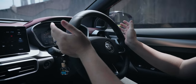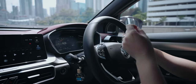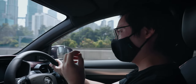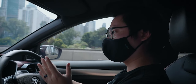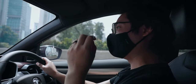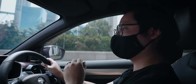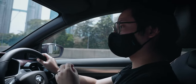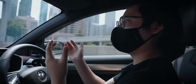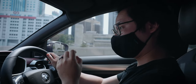Now, you may be wondering, if a car already has level 2 semi-autonomous driving, why get Kommu Assist? Well, for a couple of reasons. Even though some cars do have an ADAS system, they don't really support stop and go traffic for some models. Like my own personal Civic, for example, does have stop and go traffic, but it requires me to step on the pedal when my car has been stationary for about 3 seconds. But with Kommu Assist, there is an auto resume function, so I don't really have to press on the pedal. It will just keep on following the lead car no matter how long my car has been stationary,